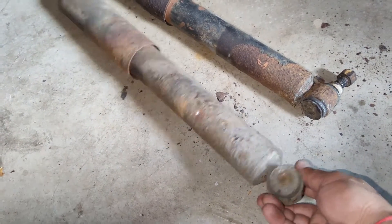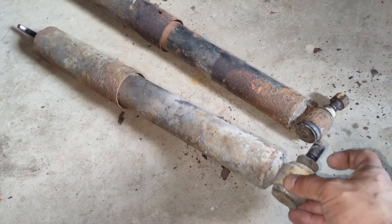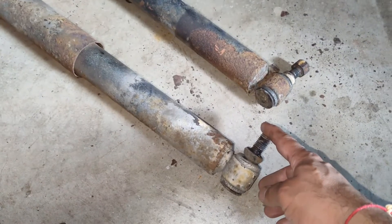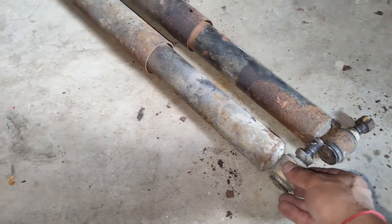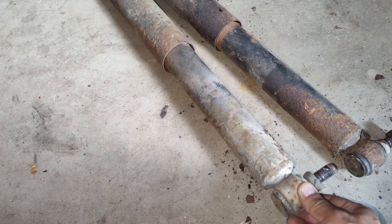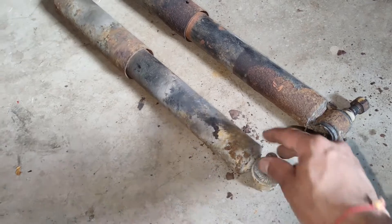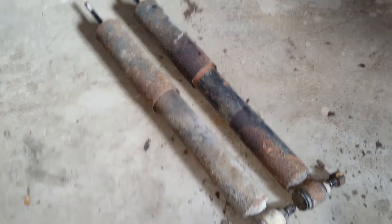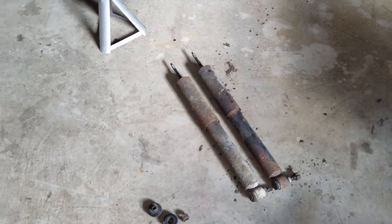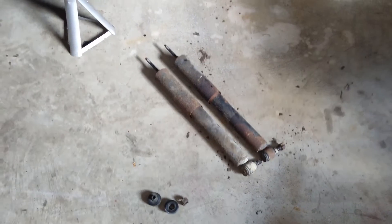Just want to point out a couple of things. If you are replacing these shocks — and these look like they are original judging from the bottom bolt — they will not come out of here as they're staked in. So if you're replacing with original-style shocks, you will need new bottom bolts. If you stay tuned, I'm doing a relocation kit at the bottom which swings them this way instead, and that changes everything because you will need center bushings and different bushings. I'll have some of that in the description. I thank you for watching.